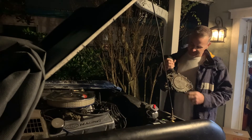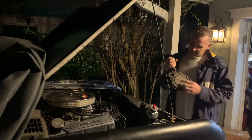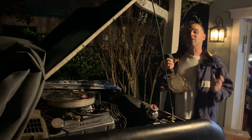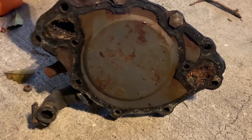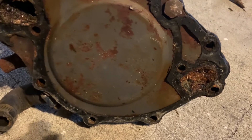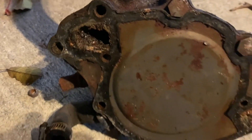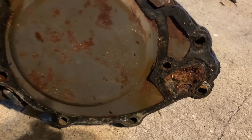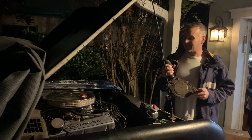As you can see here, you've got the inlet and outlet ports on it where the water is flowing. We've got a little bit of blockage on this side, but this one is completely blocked at the water pump. And also on the block, it was completely blocked by corrosion. So this engine was not flowing any water at all — maybe just a trickle through some tiny cracks in the corrosion, but probably not flowing any water at all. So it's actually surprising that it was running at 225 and not overheating the whole time.